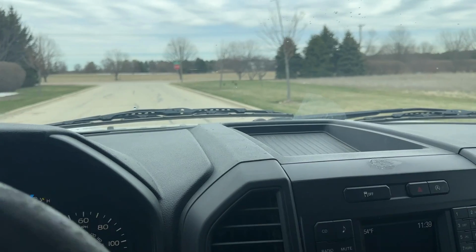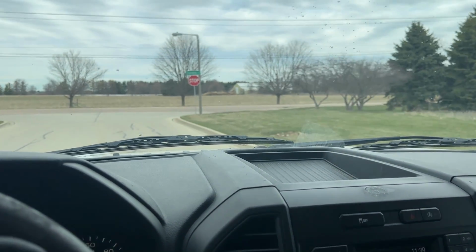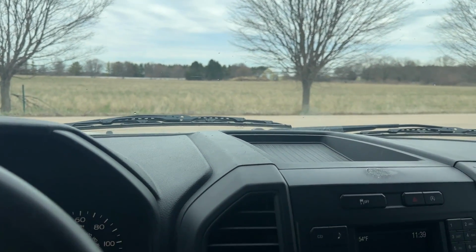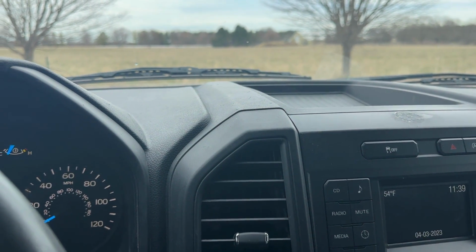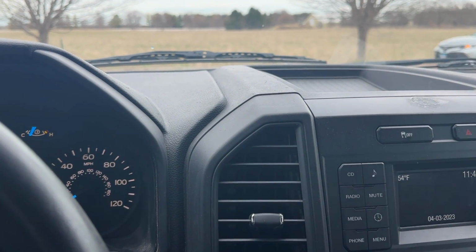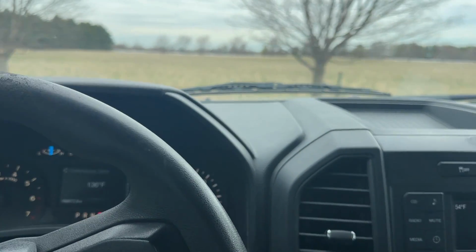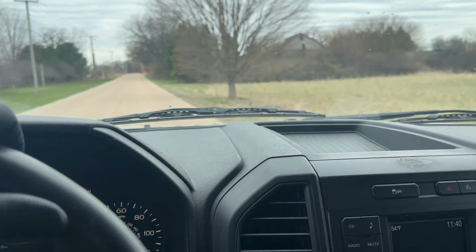Everything was done very meticulously with a brand new engine because it was still a current model year, and the thing came back like a week later with crazy misfires all over the place, random, for no reason at all. And the reason being was that it needed to relearn the misfire profile correction. It causes ghost misfires. That woman did not look happy. So it's very important on these newer engines to learn that.